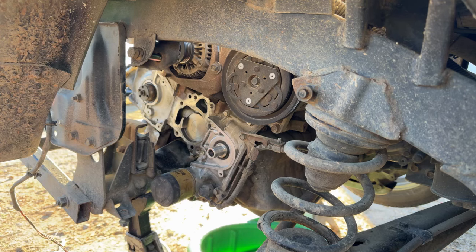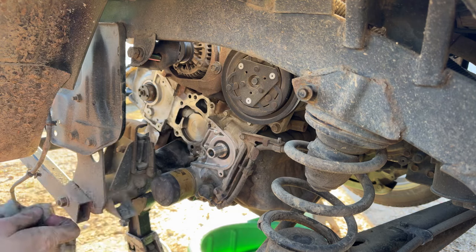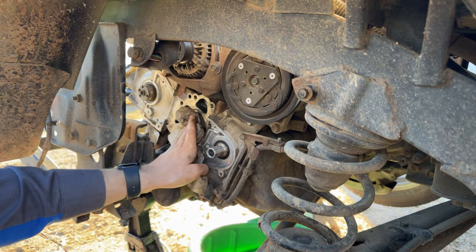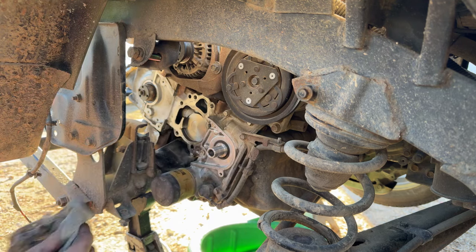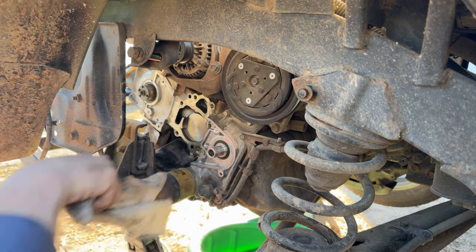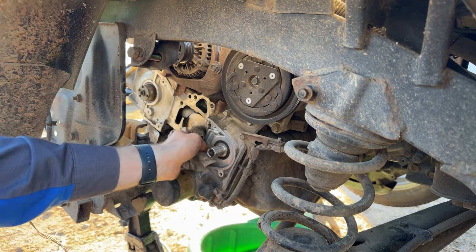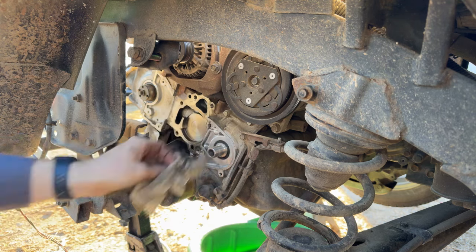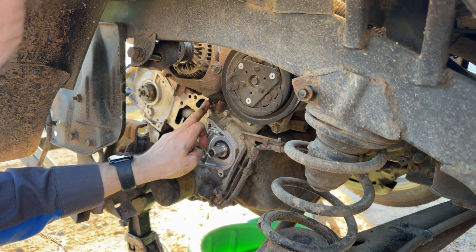All right, that's much better. I said I wasn't too worried about it, but there I am still working at it. Honestly, with this being steel and not aluminum, I could just go get a regular Roloc Scotch-Brite pad and get it with this and not really hurt it, but I've just got so many of the 3M bristle discs because I'm used to working on EJs and F-Series that are aluminum, and those Scotch-Brite discs will eat that aluminum up before you know it, whereas the 3M bristle discs are nowhere near as abrasive.